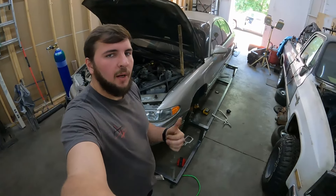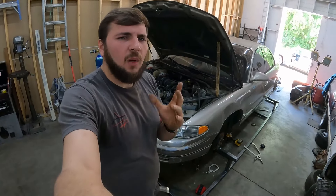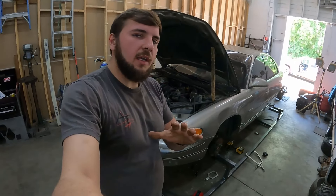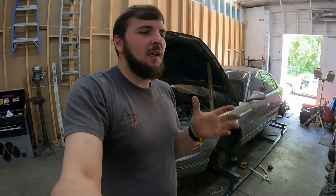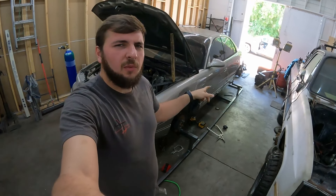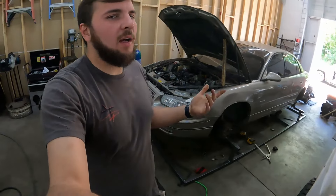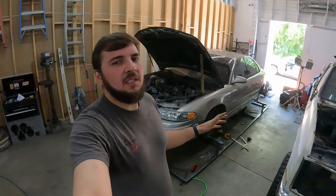We're going to get rolling on this thing. I've got to rip it down to bare body — I know the modifications that need to be done. I don't have the Mustang donor car yet, and a lot of people have asked why not use Camaro stuff, G8 stuff, CTS stuff. It's just not the proper design — it's not set up the way this body is going to accommodate it properly. If you watch the Suzy Q videos, you'll see just how ridiculously close the Mustang stuff is to the W body. The back wheels' track width is a little too wide, so you need a really high offset wheel to keep it from sticking out. But it works really well, and if you look at Copart, there is an abundance of wrecked Mustangs — and I wonder why.